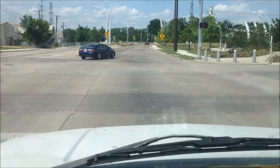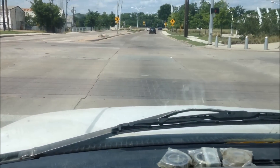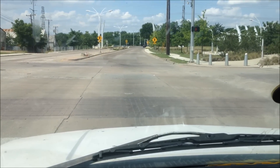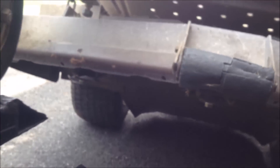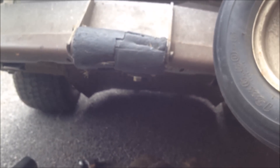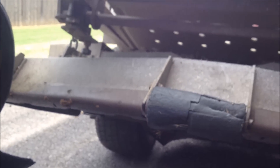Well, we got lucky on this one by extracting that bolt with a screwdriver, a punch, and a hammer. I'll put a link in the description below on how to remove broken bolts that are stuck. You can either drill them out, ease them out, or use the method I just talked about. We got the broken bolt out of the spindle without having to replace the spindle or the shaft — that's good. If you have any questions about Grasshopper mowers or how to get broken bolts out, let me know. Mower Medic One — have a great day, see you on the next video.